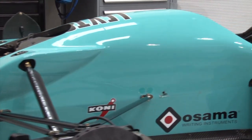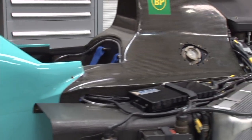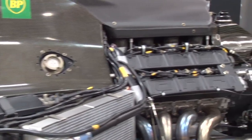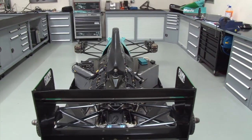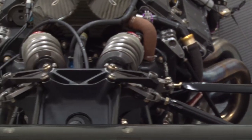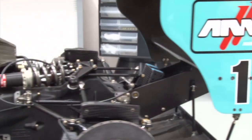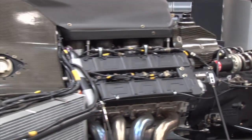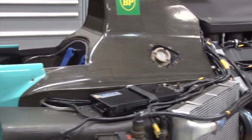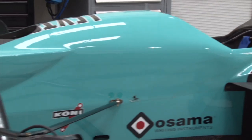Judd's 1990 EV V8 engine must be preheated before it can be started. On the track, the engine operates in a very small performance envelope. At tracks like Monza, the driver will use full throttle for over 70% of a lap. As a result, the engine runs at a high but stable temperature, so when it was designed, its components were optimised for only these running conditions. This is because different materials — aluminium for the cylinder block and the steel of the crankshaft — expand and contract by different amounts as the temperature changes. At room temperature, the engine is so tight it's only just possible to turn over.